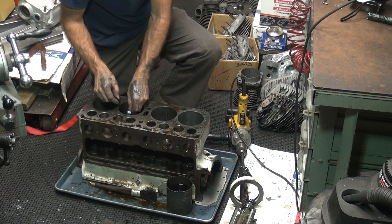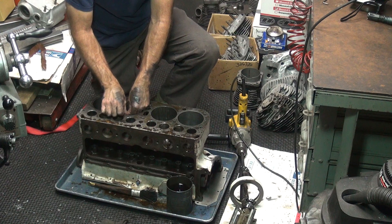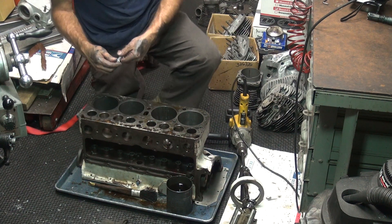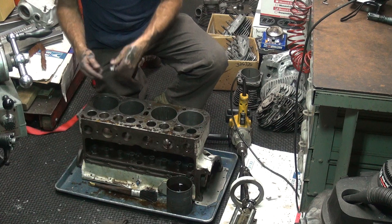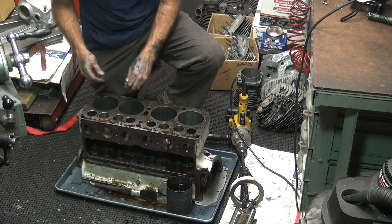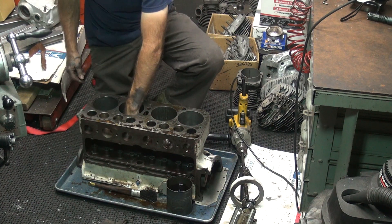This one's tight here, but this one here just falls through. I've got a couple thou to go on that. Two, three, four thou it around. Bottom's a lot smaller. Just under three thou taper. And we're out of round again on the bottom. Of course, it's the opposite of the top, so I twist.